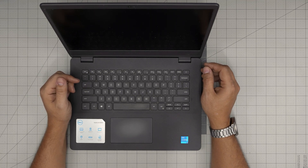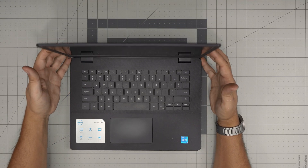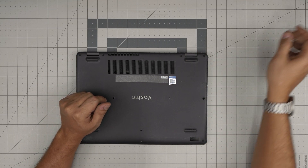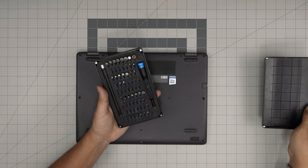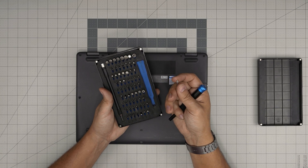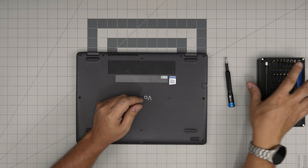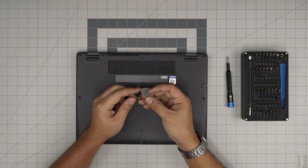I'll leave links for the tools I use in the description so you can check those out. First thing first: tool number one, a very important one, is a good screwdriver set. I always recommend the iFixit screwdriver set — they have some of the best bits, made of S2 class steel, so they never go bad. You're going to use a Phillips number one. The pro set is a bit more expensive but comes with opening tools and tweezers. Otherwise, for opening tools, I use a metallic guitar pick.